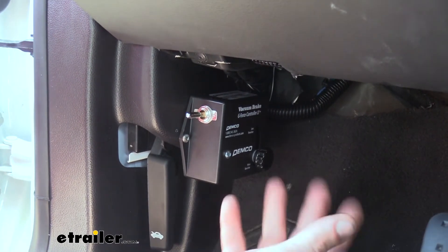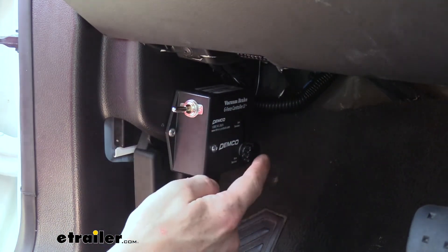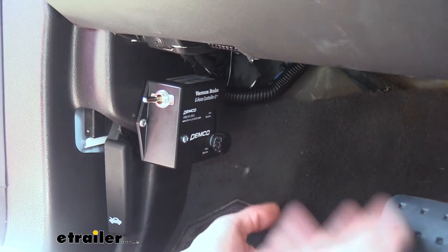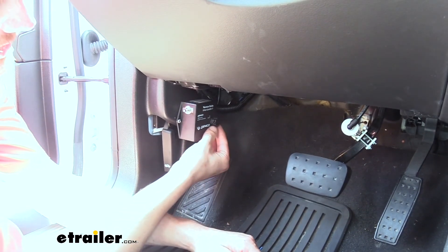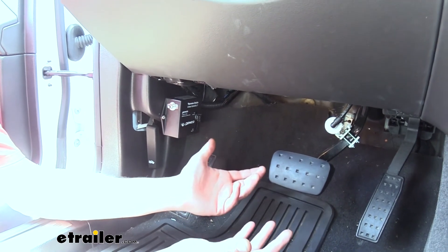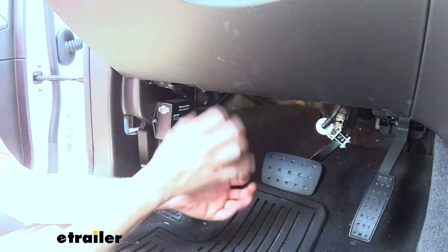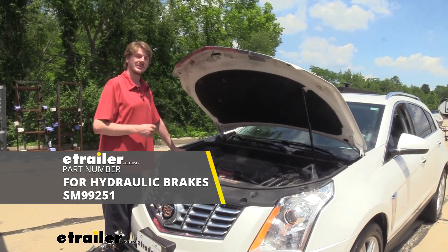Now that we've got our system installed and hooked up to our motorhome, I turn the hazard lights on the motorhome because that gives a pulse of brake signals to the back — your turn signals and brakes use the same circuitry, so it acts as a brake pulse. As soon as I turn the unit on, the pedal should activate. We're going to adjust the sensitivity so that when sitting still with no movement, it does not activate the pedal — we only want the pedal to activate when the internal inertia sensor detects movement. Loosen the nut and push upward on the adjustment until it stops, then go up about an eighth of an inch and snug it down — that's your baseline starting point. Drive your motorhome as normal and feel how it responds. If your vehicle is pushing a little when you stop, push the adjustment down a smidge for more sensitivity; if brakes are applying too hard, go up further to lower sensitivity. That completes the installation of DEMCO's Stay and Play Duo supplemental braking system on our 2016 Cadillac SRX.